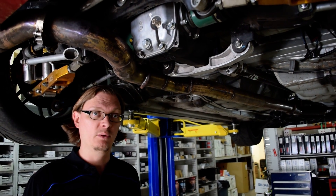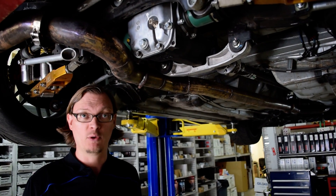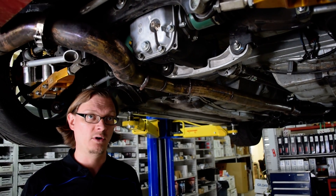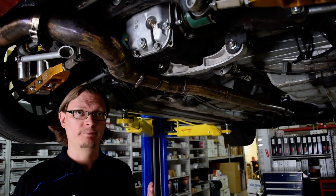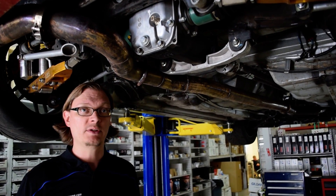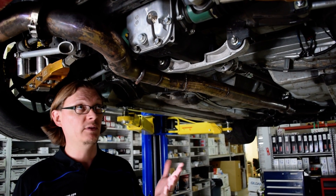You'd either have to retrofit an older WRX rear diff — basically from 2002 to 2005 only, since 2006 and 2007 are also different — or put in an R180. An R180 is more durable, so there are some advantages in going with it, and that's what we've done here. This is an R180 diff in our 2014 WRX.